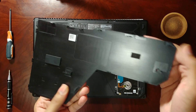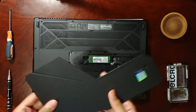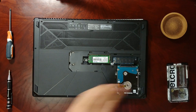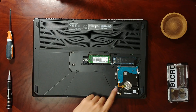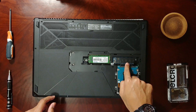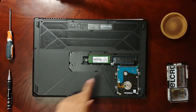Now it's off. These are the little clips I was telling you about — you do not want to break these. There's one area here. Keep this somewhere safe along with its screw. Next, you want to take the hard drive out, and the SATA connector here along with the power connector, and there's another connector over here. I'll start with the hard drive.